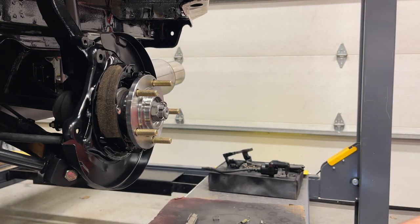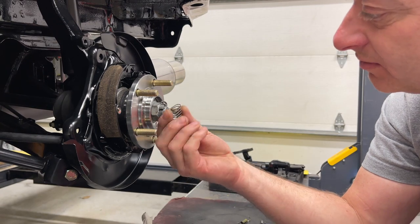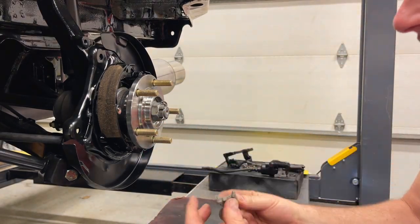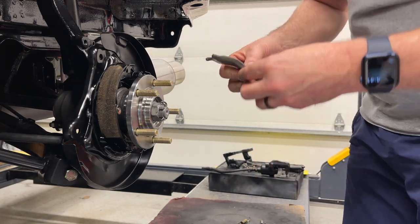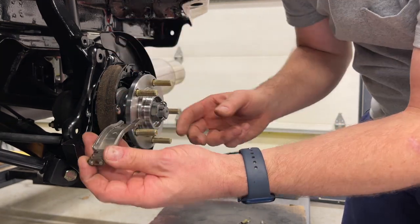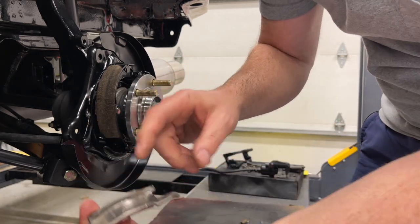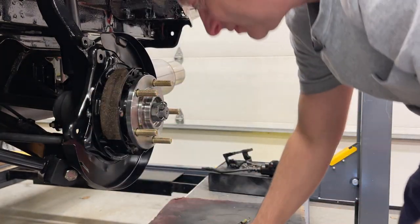Now, let's put this spring in to kind of hold it together. Put the spring in. Okay, let's get this in. Okay, that's in. This is called a strut, and there's a kind of a rectangle spring that goes on it as well. And you set that in there. And it goes in, so the spring is on towards the front, and it says L on it for left, by the way, and the other one will say right on it. There, kind of sprung together.